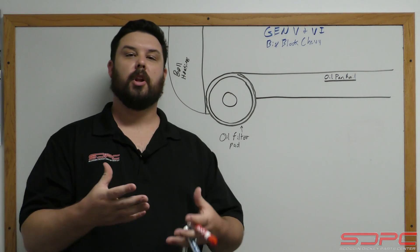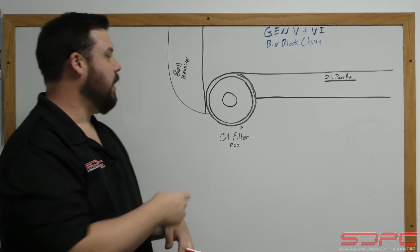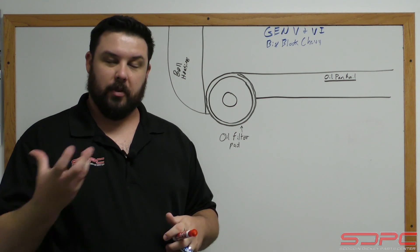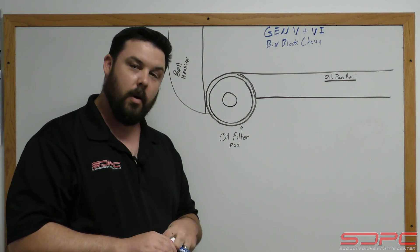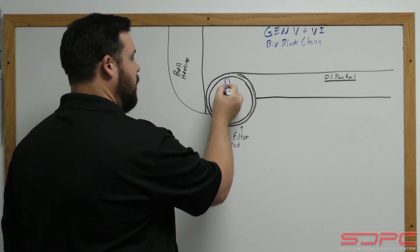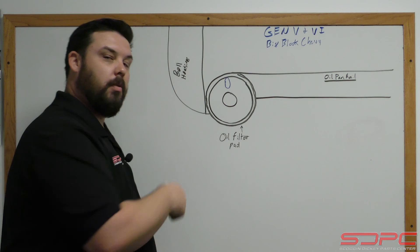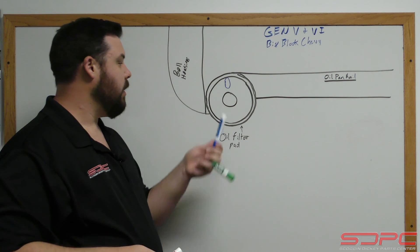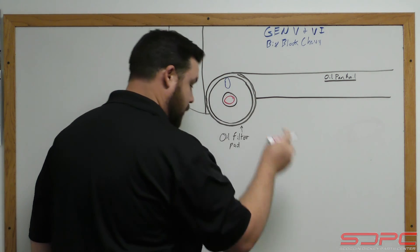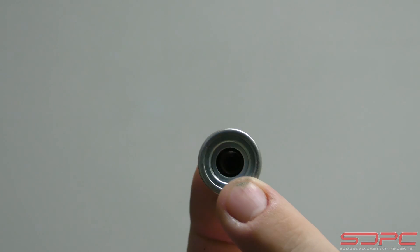If you were crawling underneath your vehicle where the oil filter is — here's your bell housing, your transmission, that's the front of the car — right here is the pad where your oil filter screws on. This would be if your oil filter was taken off. What you're going to notice is there's an area where the oil comes out. It should be a weird oval-shaped hole, maybe coming in at an angle — that's what actually feeds the oil from your oil pump into your oil filter. Then the return out of your oil filter is in the center and you might see a little valve in there, which looks like this metal piece here — kind of like a thimble.